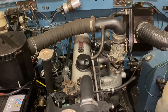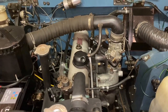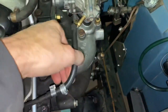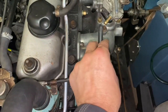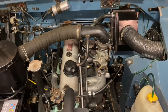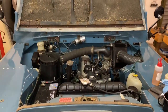I've got to refit the fuel line - I'll put a new one on and make it a little bit longer so it's not pulling. That's everything back together. I'm going to clear up a bit and then push it outside, get the car started and see how it runs.